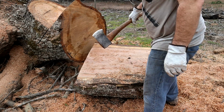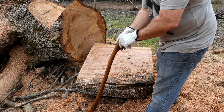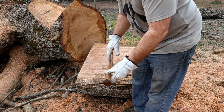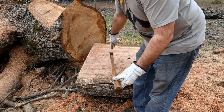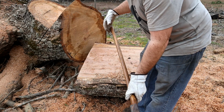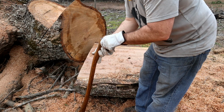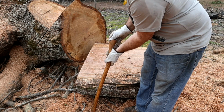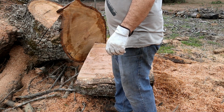There we go. Man, I tell you what, as hard as you try to pick out the right handle, I was hitting some wood with this and I was like, why is it jerking out of my hands? I don't know if you can see down the barrel here, but the wood was twisted when I got the handle, and now the handle is pointing this way and the rest of the handle is pointing in line with the head. So I had it halved perfectly with the handle, but then the handle went to the natural twist of the wood. So I'm gonna have to rehandle it, and that's too bad. I like this handle. I like this handle profile a lot. Nice and skinny and round down here, and then nice and fat up here. That's too bad. All right, 660.